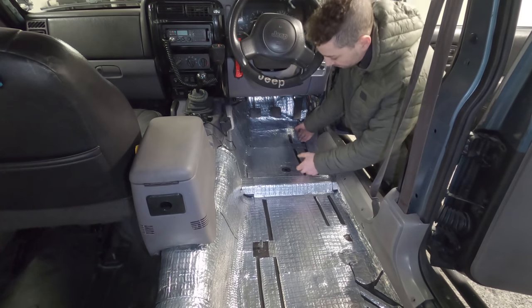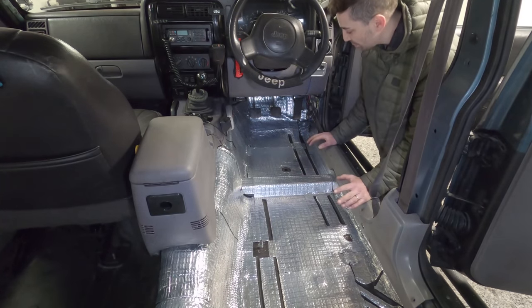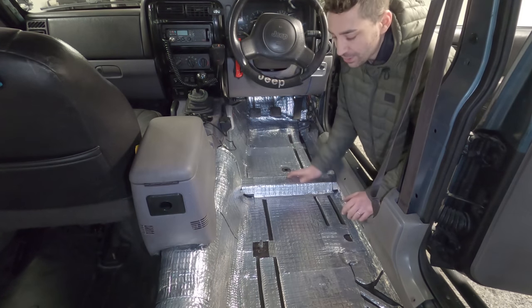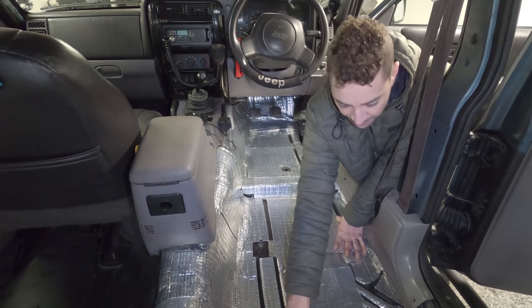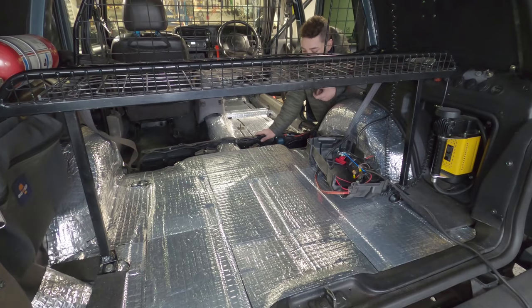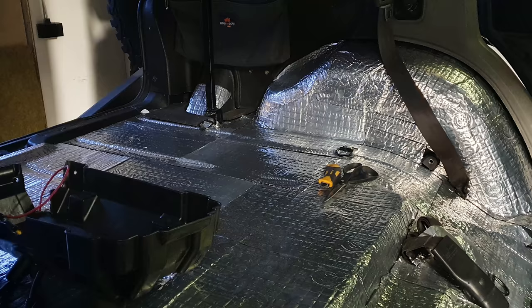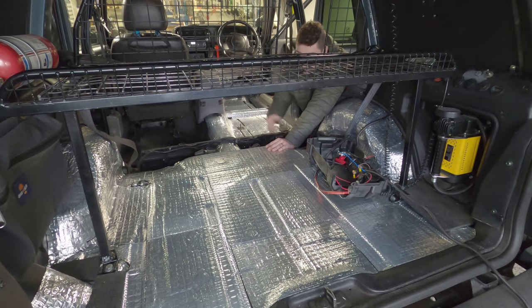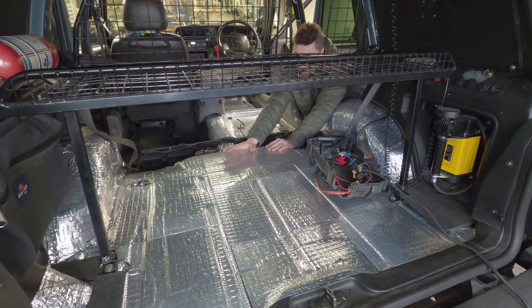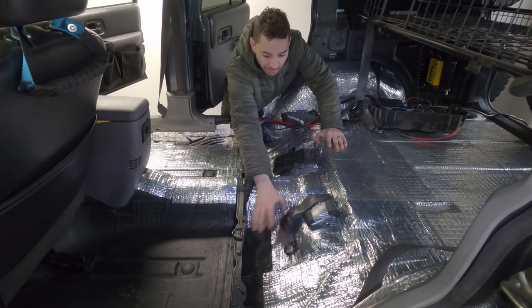If you do a lot of mud plugging and get water in the vehicle, it might be a great idea to build your own drain plug at the lowest point. I haven't, but it gives me the ability to take away the Rugged Ridge mats, look underneath, and know any snow and water can find its way out somewhere - I can mop it all out and maintain the vehicle. I've done it this way because I'm very mindful of my previous corrosion experiences. I've also stopped the Silent Coat just short of certain areas at the back that always see water.